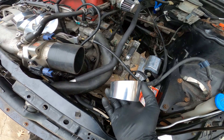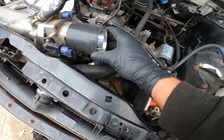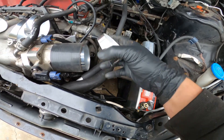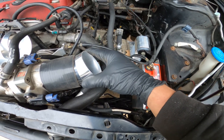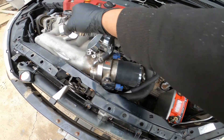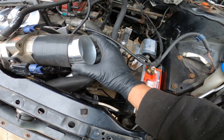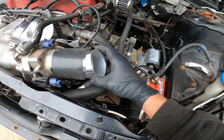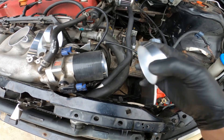I got a few pie cuts cut. This straight one goes in first — you always want to start off straight; as you can see it's pretty close to hitting. The next one is an actual pie piece; we put it in here and just start working our way around like that. We're basically just putting these in until we get something that fits without obliterating the lines. We can change the angle — right there it clears. I'm going to go ahead and tack all these and show you what I'm talking about.